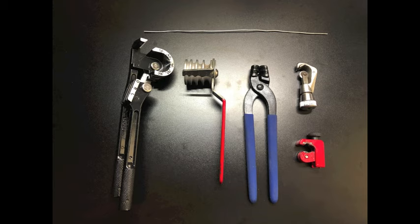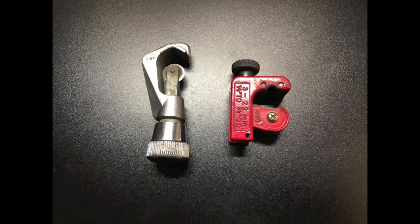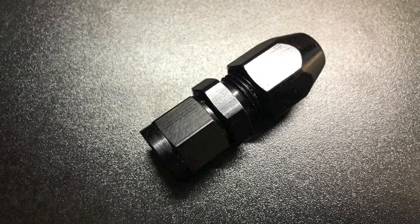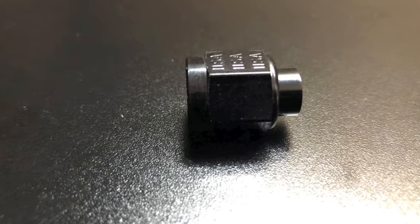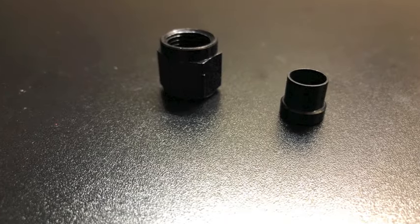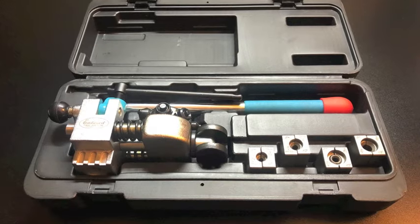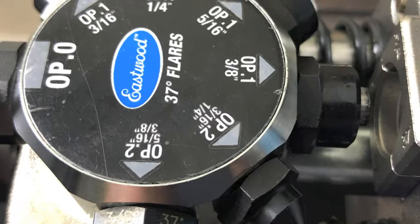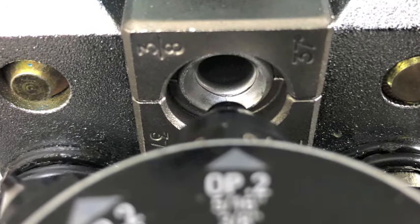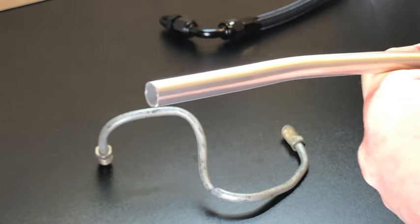To get this done I needed several tools, some tubing benders, and a tubing cutter. There are several different ways to go about doing this. In this video I'll go over two: how to use compression fittings, and the 37-degree flare fitting, which is the one I decided to use. To do this you'll need a tool that can do 37-degree flares. I went with the Eastwood flaring tool because I could also buy a 37-degree flaring kit and use that to do fuel and brake lines. On my next video I'm going to do a review on this tool.